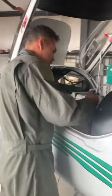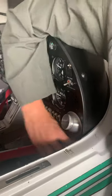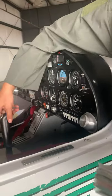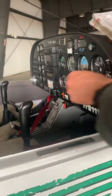Next we verify that the tachometer looks good with no discrepancies. We're going to remove the flight control lock — unclip it from here and from here, then remove and pull it, making sure it's free and clear. Then we check the left and right ailerons and the elevator to make sure those move freely.